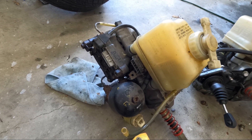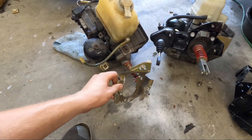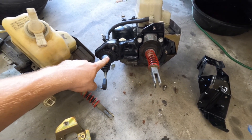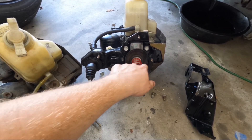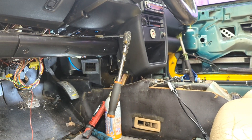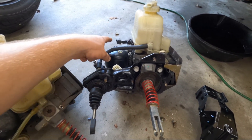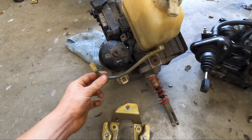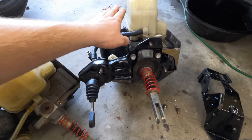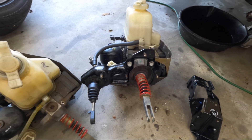Here's the old one I pulled out — glad to be replacing it because you can see it's all rusty and corroded. This one's in much better condition. A few differences: this bracket on the back is different because this one came out of an automatic, versus the manual which has the whole bracket with the clutch master on it. You've got three bolts right by the brake pedal and steering column — the top one's a bit annoying, so I just popped both pedals off and soaked them overnight because they were really rusty. I painted up the brackets since they were just real rusty. I also replaced the reservoir line because the old plastic one was rock hard and swollen. I replaced it with a quarter-inch fuel line — that is not recommended because it won't hold up to brake fluid — I do have the correct one ordered, but for now it'll get us by.